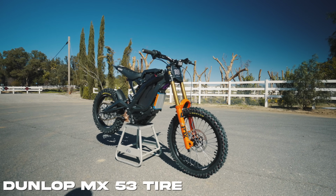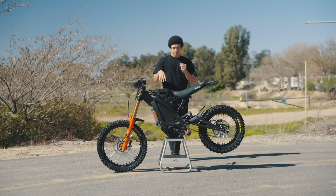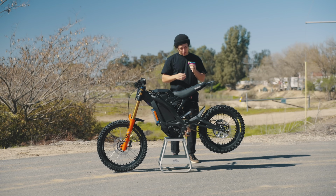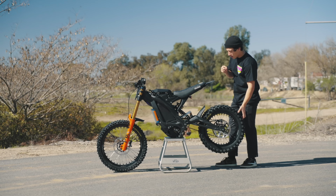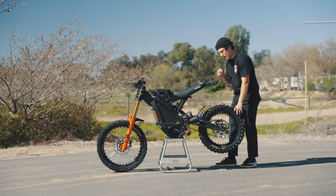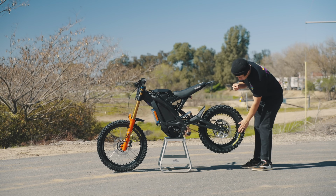I would not recommend getting a 16 rear for stock power though. I think if you are gonna get a 16 rear, having the 72 volt or the 60 volt with the BAC, then it'll be worth it. But with stock power, I think it's just too heavy and it'd rob too much power. That's just my personal take on it.